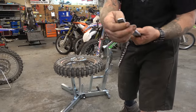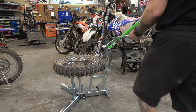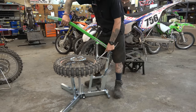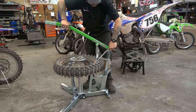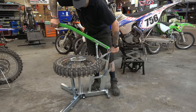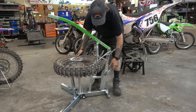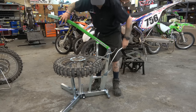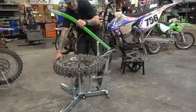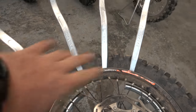Oh, you're going to want to take the flat end or the more straight end. We're going to come in like this. We're going to hook into the tire this way. Take our bead breaker, we're going to push down and put it all the way in. You can kind of feel it click. Right, we're going to come over here, go about 4 inches. There we go. Now, I'm going to spin it. Let me show you what this looks like, guys. Here we go. Got those four.